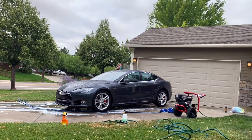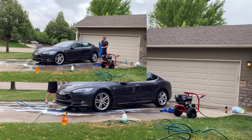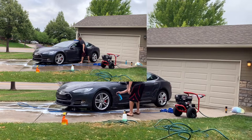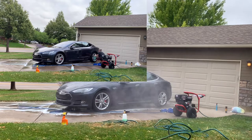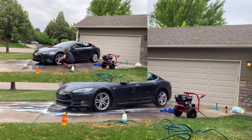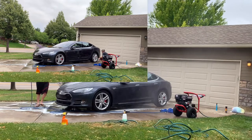After that, the next step is to get microfiber towels and dry your car. If you spend the money on a nice big microfiber towel made for drying, it makes it a lot quicker. Start at the top and rub the towel back and forth to get all the water off. I actually use two different microfiber towels to get it completely dry. Then you're going to dry off your rims with another microfiber towel, and at the same time you're wiping off anything the wheel cleaner and power washer didn't get. Because I use a protectant on my rims, it all tends to come off when I rub it with a towel, getting it back to a nice pristine look. Then I reapply the protectant so that dirt and dust doesn't stick as much.